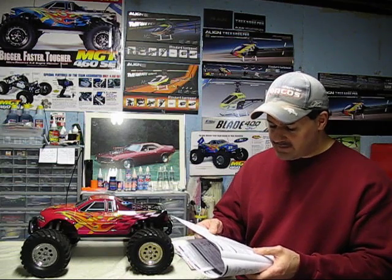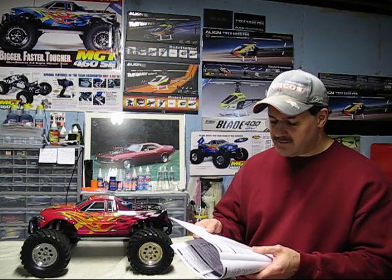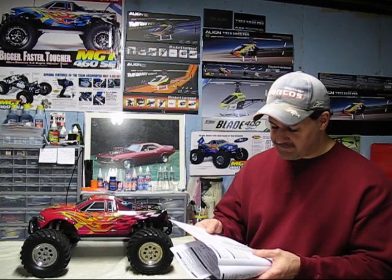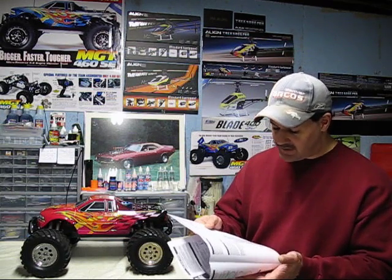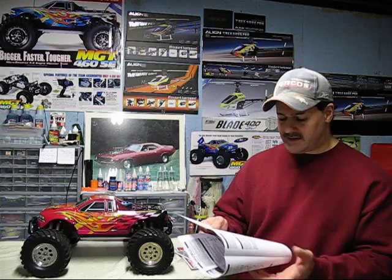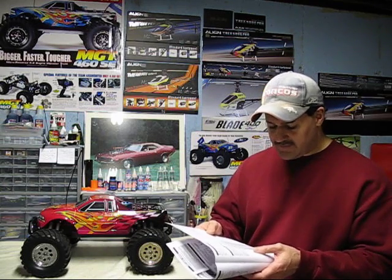If it's overheating, they're saying to allow the engine to cool, and then richen the fuel mixture. Also, the carburetor could be incorrectly adjusted. You have to readjust that. The exhaust, if the exhaust is blocked, clean the exhaust system, obviously. And if the air filter is very dirty, that can also block it up. You've got to clean your filter. If you're using a starter, a pull start, that can cause problems.